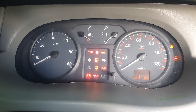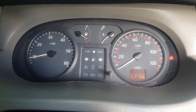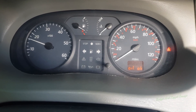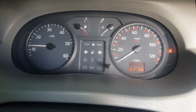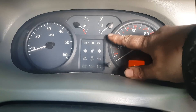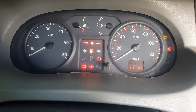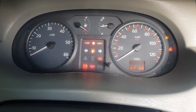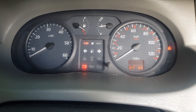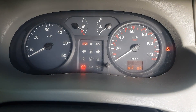Let's just see if it's all still okay — will it still start? There we go, still starts. I don't like the way it's revving up — EGR valve is still bad. We'll do that in another video, along with the temperature sensor. The temperature reading goes up when you turn the ignition on and then goes down, which is weird. You can hear the fans kicking. That's it for part one — please like, share, comment and subscribe. Most importantly, never forget: get your hands dirty. See you for the next one — part 2 coming soon.